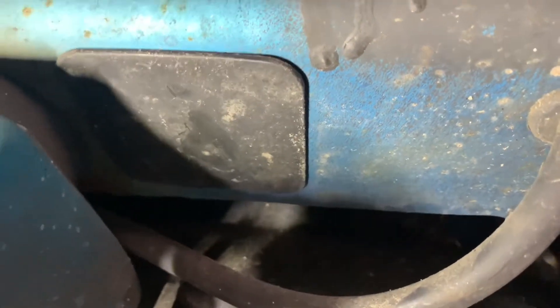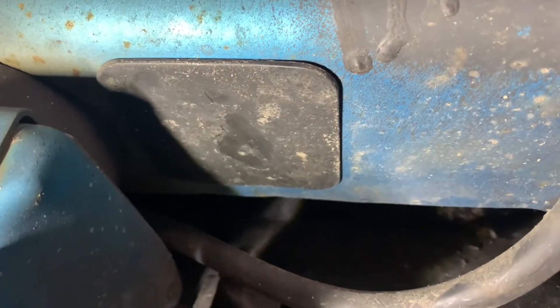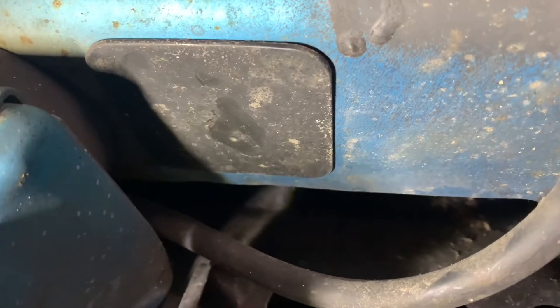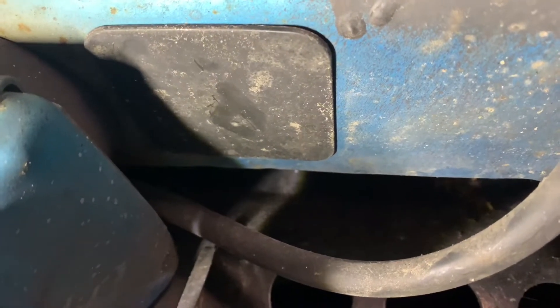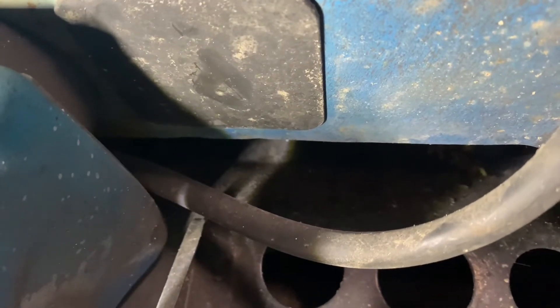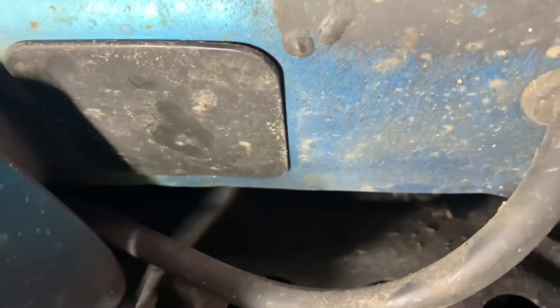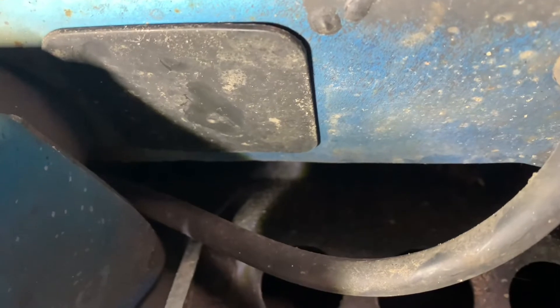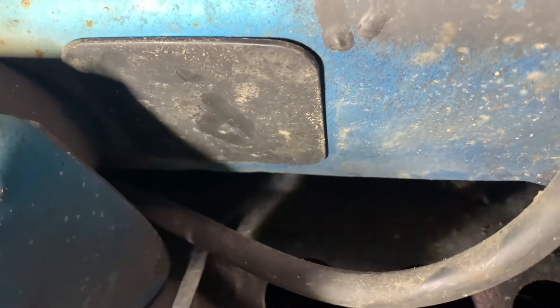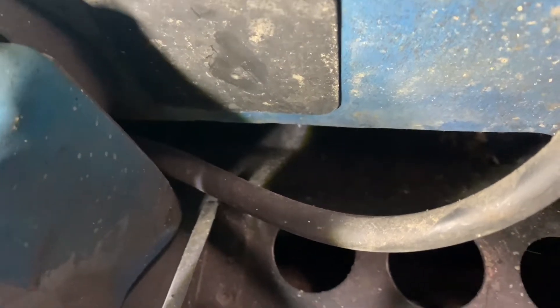Now, I'm not going to unplug it all the way, because I still don't want debris and stuff like that to get up there. So what I'm going to do is just cut it like an X and pass a plug through there. But the wires will still be somewhat tight and cover, stopping debris from getting up there to behind the taillight and stuff like that. I'm not going to take it off completely — just with a box cutter, make an X or a cross and just run the plug through there.